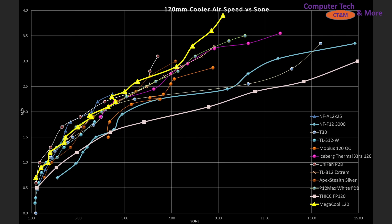Also, once again, we're taking a look at Sone. Sone changes that exponential behavior of decibels into a linear behavior where every increase in Sone is proportional — 2 is double 1, 4 is double 2, 8 is double 4 — as opposed to doubling every 10 decibels. This Superflower Megacool is not quite the chart leader, but it's really darn close. At higher noise levels and higher airspeeds, it is the chart leader. Up to around 3 meters per second it's not quite number one, but nothing else really competes with it at that really high airspeed, high RPM range.